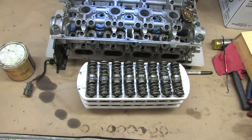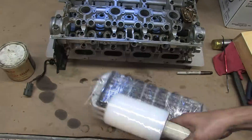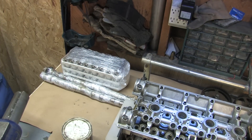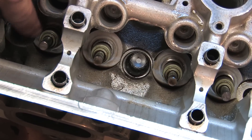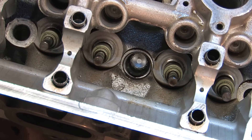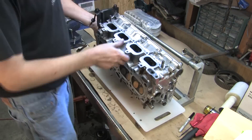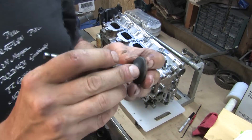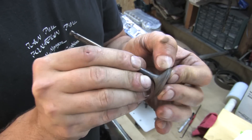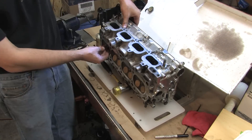Now that I've got that all together, there's one more thing I want to do. There's the valve train. What we have here are the spring seats, which are a third of the equation for the spring installed height measurement — we'll get to that. All that's left are the valves and the valve stem seals and we'll have a bare head. The valve stem seals pull off easily with a pair of pliers and you'll throw them away. Let's flip the head over and remove the valves to get a better look at the seats. Flip the head up on its side and push the valve stem so you can easily snatch it and pull it through. Take a look at the seat area and the valves to ensure that the contact surface is even around the face of the valve. I like to use a pizza box to keep things organized — just like with the ice cube trays, I mark an I and an E on the cam gear sides. This just makes it easier to keep track of things for what's coming up later.